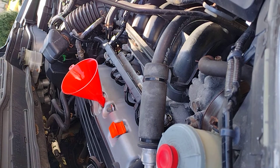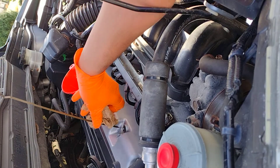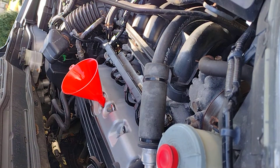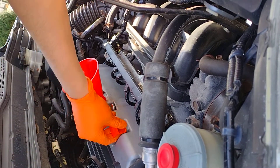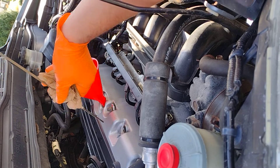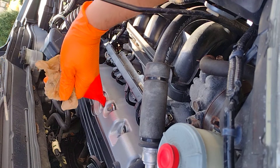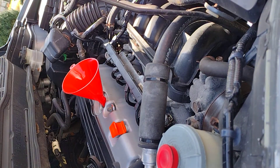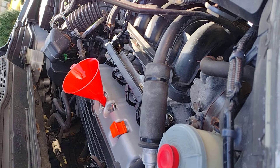I don't want to put too much oil in because the MOA is taking up some volume in there. I take the oil dipstick, clean it off, put it back in, and inspect it to see what the oil level is. It looks like it's topped off, so I'm gonna give it a little bit of time to settle since oil is still draining down — I want to make sure I don't get the wrong reading. In the meantime it should be fine to turn on the car.